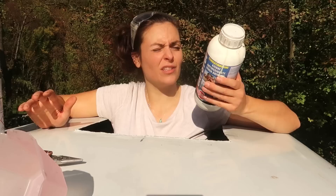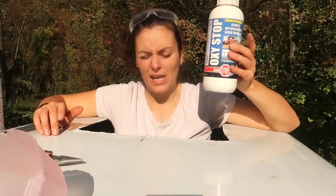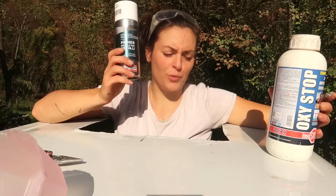Now I have some bare metal that I need to take care of, so I'm going to apply some anti-rust — actually this is a rust converter. I don't know if it's the same thing but I guess they do kind of the same job. So I'm going to apply this, let it dry, and then apply some filling primer. That's just to avoid any rusting of the metal.